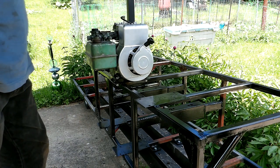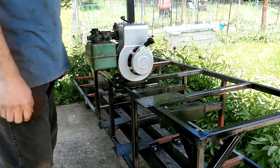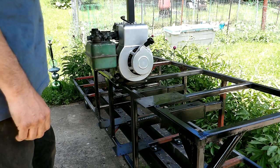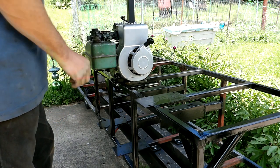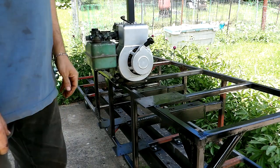I've got another engine here that I built up. I had some problems with it - the front bushing was tight, so it took some sanding and some crank polishing. I got her going though, so we'll see if we can get it started again here.